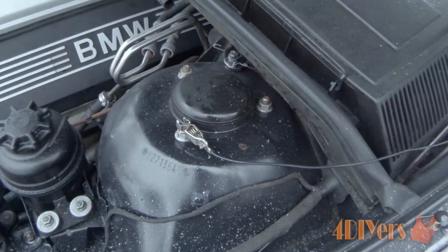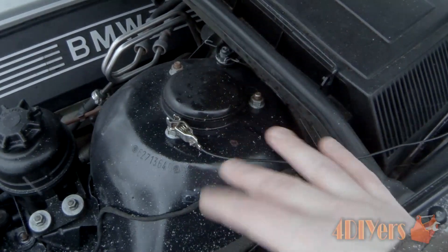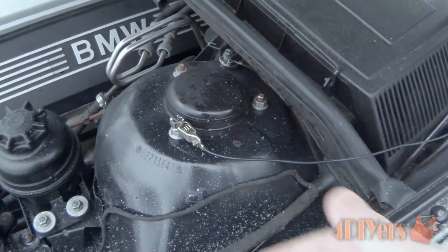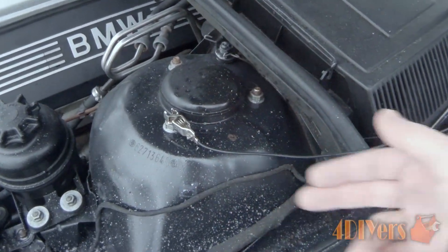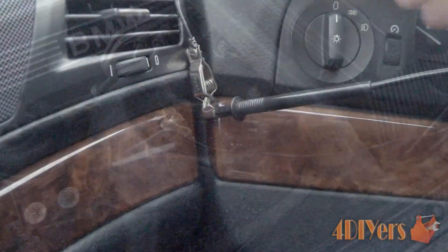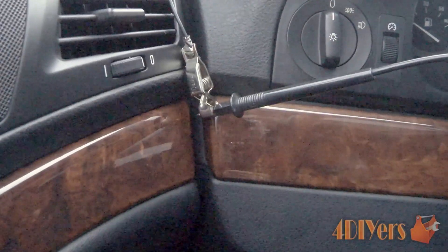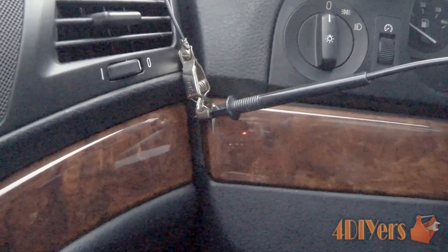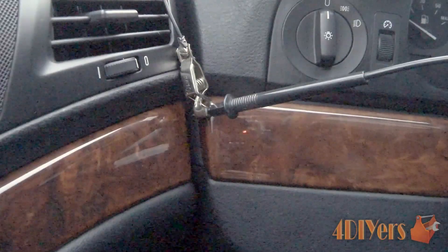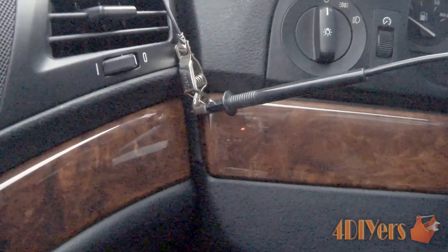In order to do a test with the switch in the vehicle, you need a sufficient ground source. I just used the bolts on top of the shock tower here, which can also be used as a boosting point, making it a good ground source. I have a long wire that extends into the interior with an alligator clip on each side — one to hold it on the strut tower and the other on the test probe. This makes it a lot easier to work with, as you only need one hand to operate the test probe. The wires do have quite a bit of tension, so you need to move them to gain access to the connectors on the backside of the electrical connector.